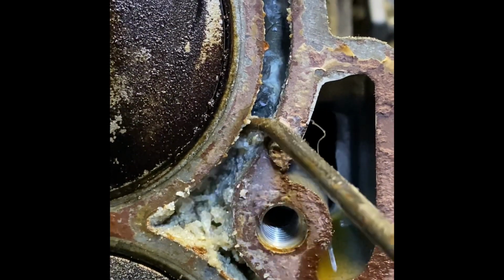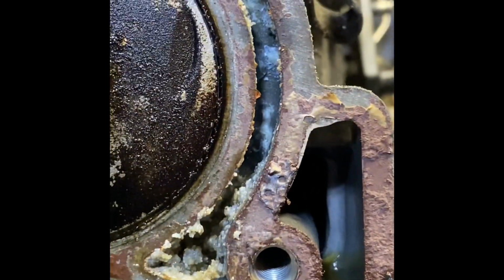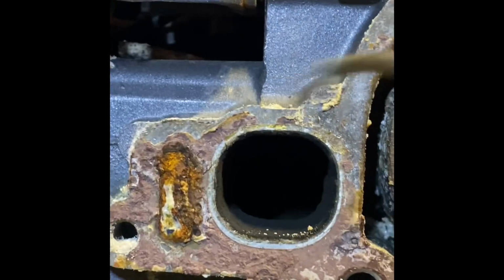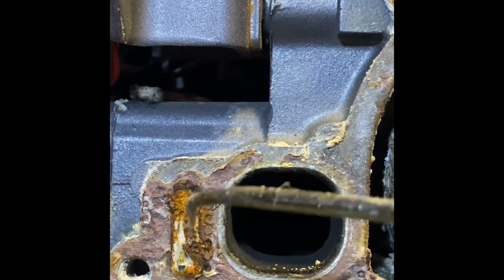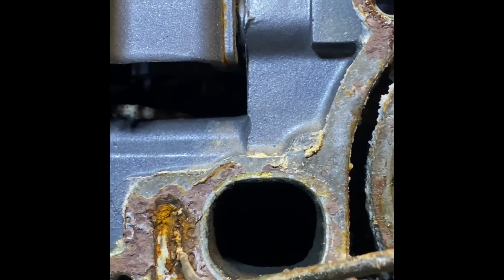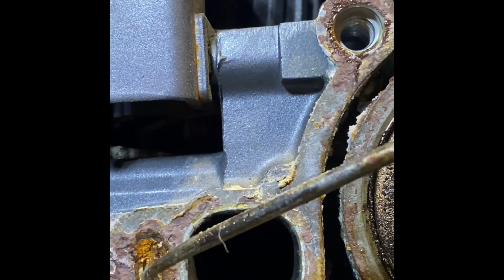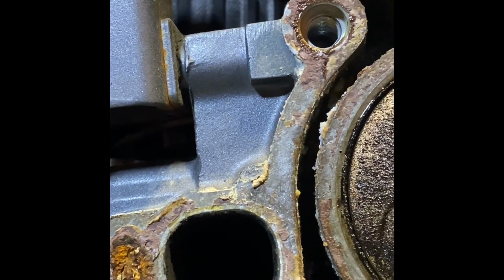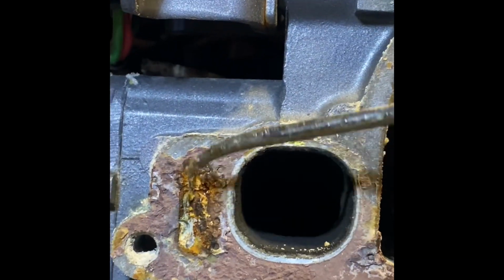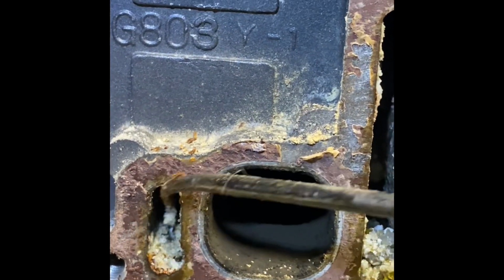and clean all this out. Okay. So, remember I couldn't get air through the top port, like I said? There's our top cooling port. There ain't nothing getting through there. I was just saying, never overheated. I might have to run a drill through that. Oh my gosh. Chaos. Bottom one? Not too bad.